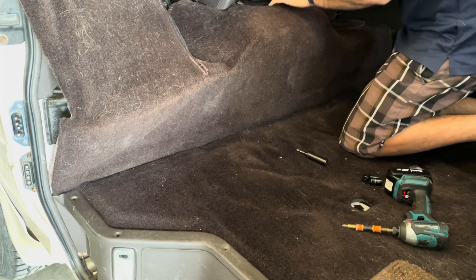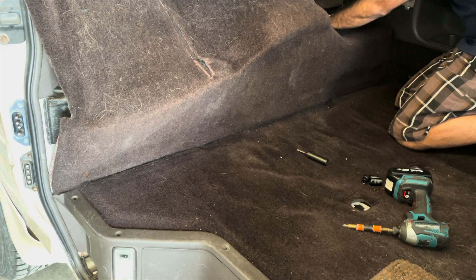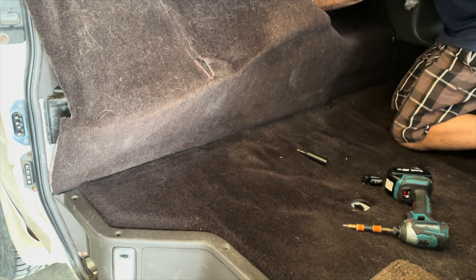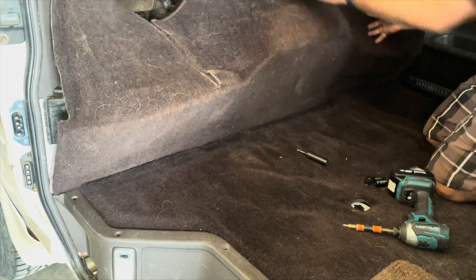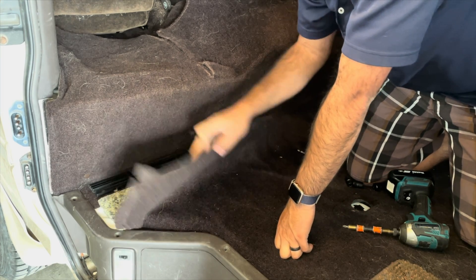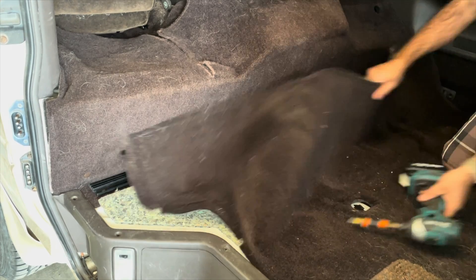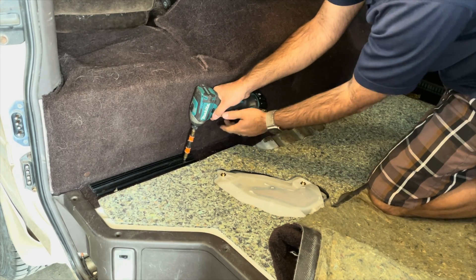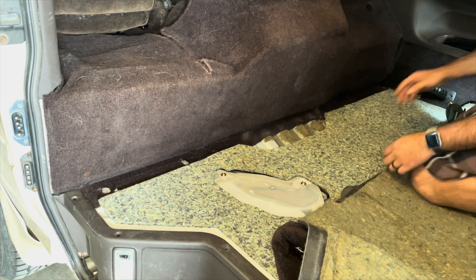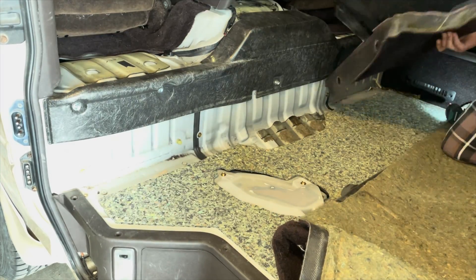So you just got to find them and push down. The rear seat has this flap that pulls up first, and then the bottom carpet has two snaps. On the middle there's another latch, but on each side there's this little plastic that snaps into this rail. There are two Phillips head screws on each of these brackets that you need to remove. Once you get that out, this whole thing comes off and out of the way.